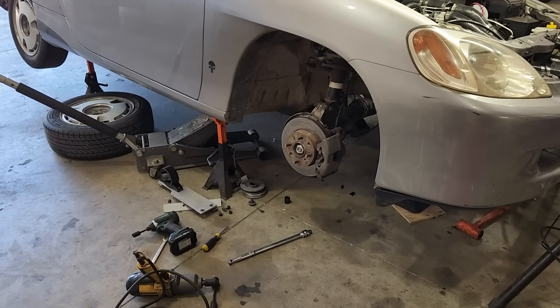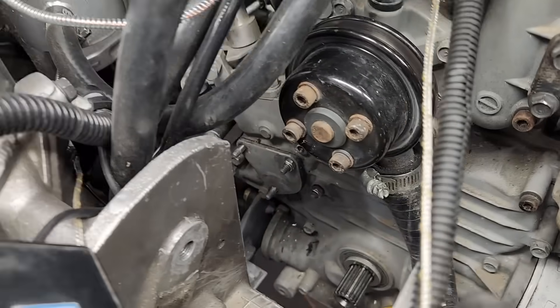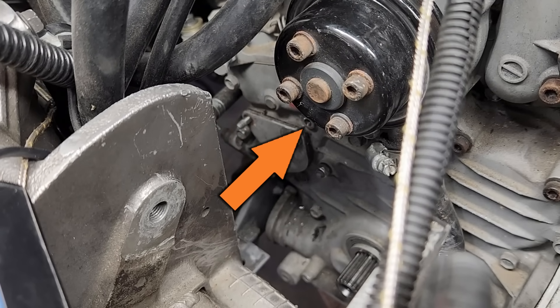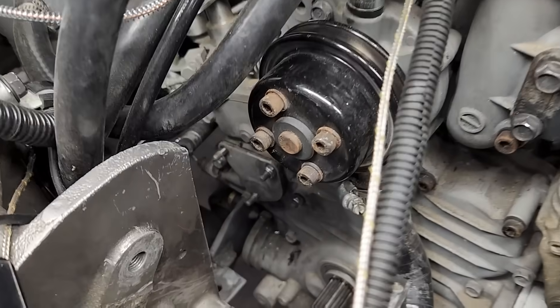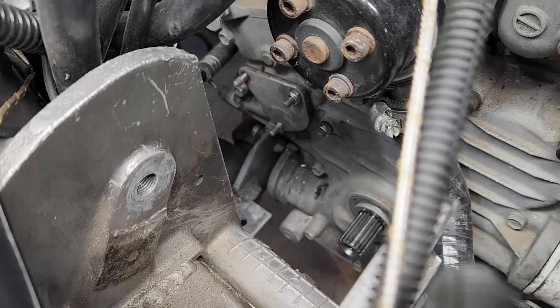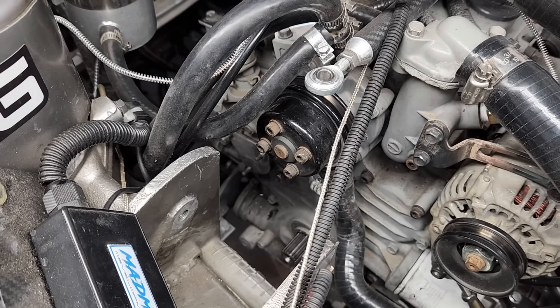The car is partially disassembled and it's been this way for the better part of two weeks. Let's take a look under the hood. Right here is where the fuel rack limiter screw is supposed to go, and it's actually an awkward location. All the stuff on the front of the engine has been removed, so it may look like there's plenty of space, but in reality there's practically zero space once the pulleys, the belts, and the front motor mount are all in place. One of the concerns we have is the potential for an oil leak since our rack adjustment gizmo breaches the front of the engine. The good news is we have a way to seal the breach, but only time will tell.